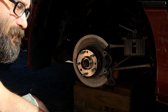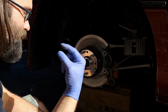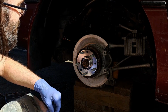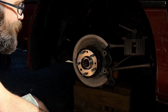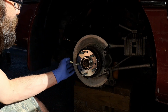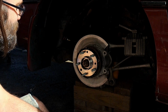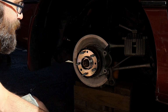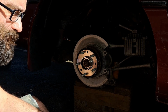And so we got a little bit of a brake upgrade. Some people might not call it a brake upgrade, but it's a little bit. Kind of limited on these older C4s as to what you can do with the brakes. The rear brakes changed in '88, and the caliper and e-brake arrangement's completely different. The e-brake mechanism is built right into the rear caliper, and it did away with this additional e-brake. So it's not really a straightforward swap. You have to change the backing plate, caliper, and emergency brake cables, and it was a little more involved than I really wanted to get into.